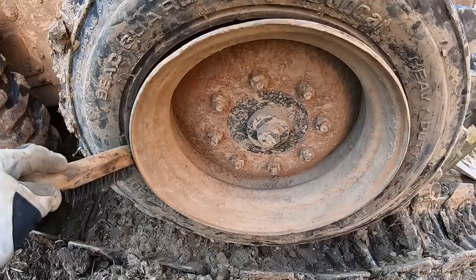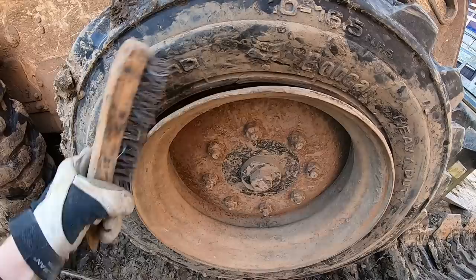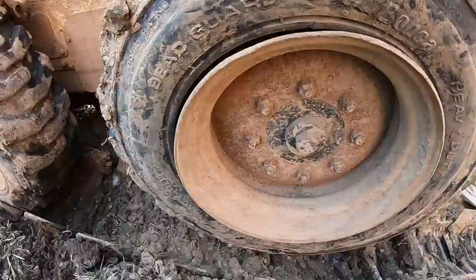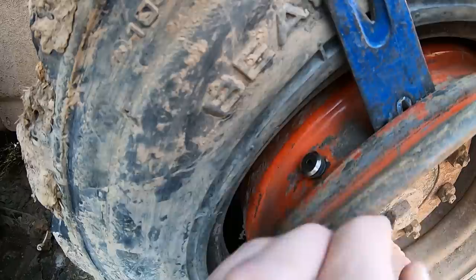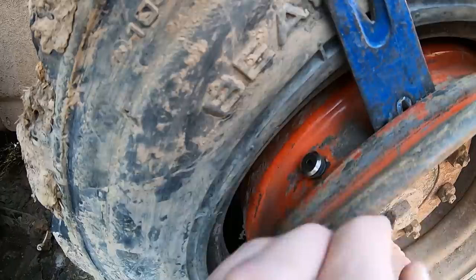This tire got driven a little bit after it popped off, so it got mud on the inside of the bead. I'll go around with a wire brush, push the tire over with two hands, and clean the inside of that bead up real good before we try to set it — if the bead has dirt in it, it won't seal properly and it'll go flat again. I cleaned up around the valve stem hole. These valve stems just come apart — you stick it through, rubber piece goes up through the middle, this piece goes down from the top, put your jam nut and washer on it, crank it down and she seals up.